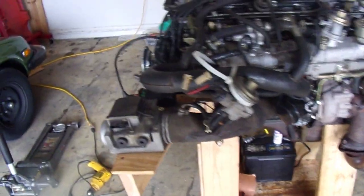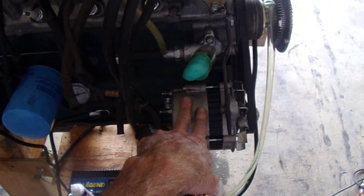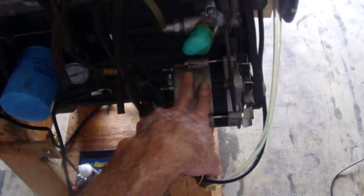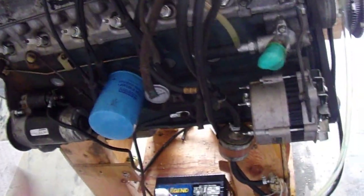The only thing I haven't figured out is what I'm doing about the alternator. This is an alternator that requires an external regulator, and I could steal it off of that setup and reinitialize it. The reason I care about the alternator is I don't want the battery to get weak while I'm running and fooling around with it.